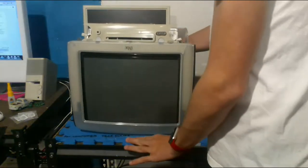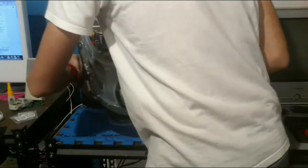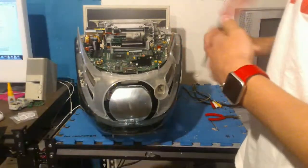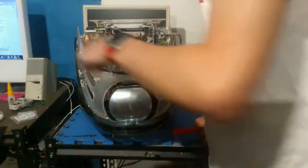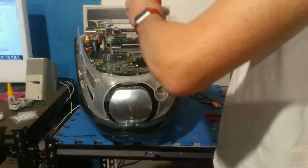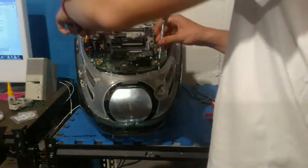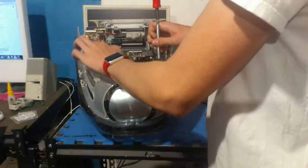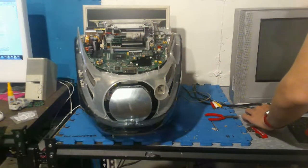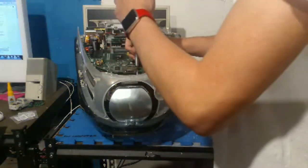So you turn back to the motherboard. You can take this out here. So we have a screwdriver. This is just a bunch of Phillips screws all around the board. They're all in miscellaneous places. So yeah, there's this screw, this screw, this screw, this screw, a lot of screws. And also, if you're wondering, this power supply board here is actually a separate piece. There's a little connector here, and you can disconnect them from each other. So if your motherboard ever dies or your power supply ever dies, you can easily replace it without having to replace the whole module.